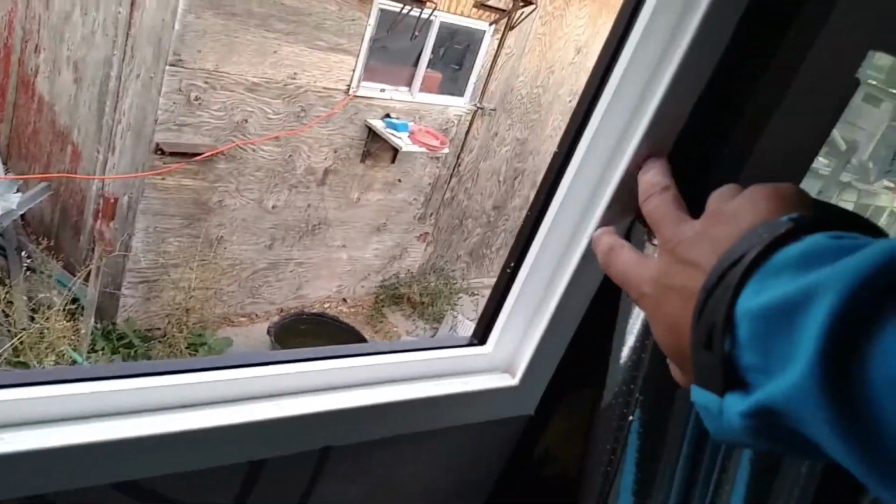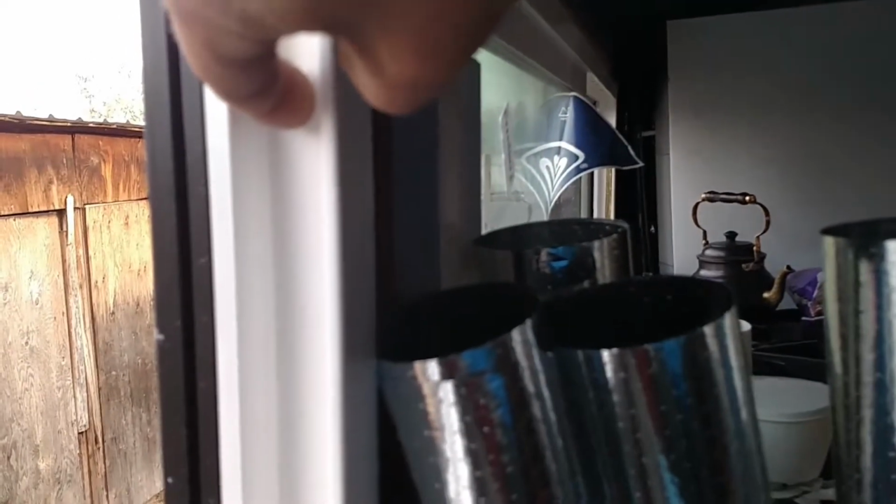But he suggested actually doing security screws. And that's basically putting a screw right here in the middle, screw right here in the middle on each side, and then some on the top. And the reason I didn't do that, there's a few different reasons. Well, I'm going to actually put security screws in here, but one of the reasons I can't do that yet is I need to put my skeletal structuring boards in first, because if I were to drill and pull a screw out, the way these windows actually sit past everything, the screw would pop out right here in the middle. And so it wouldn't grab onto anything, it wouldn't do its job. So I need to actually do the skeletal structuring, and then I can do that.